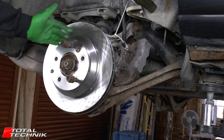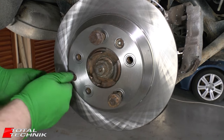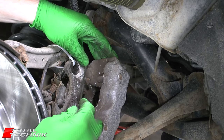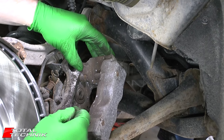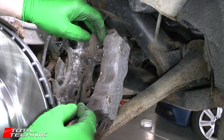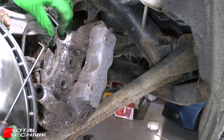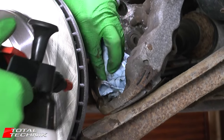For ease, we're now going to disengage the parking brake so we can go ahead and start assembling the rest of the components. Refit the little inspection cover screw — it's meant to be 14 Newton metres so don't over-tighten it. Before refitting your caliper, it's a good idea to give it a quick once-over, get rid of any debris and dirt build-up. You can put a bit of brake cleaner on there but be careful of the rubber gaskets around the pistons as brake cleaner can be quite aggressive on rubber.